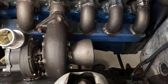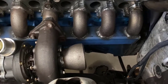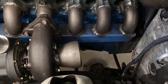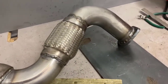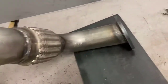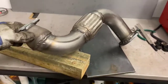Starting on the dump pipe for the exhaust. The turbo's in position, and I've got a reducer on there to go from the small turbo port out to a three-inch dump pipe. Built the dump pipe — three inch with a six-inch bend — put the flange on there. All done: measured it up, taped it, and fully welded it.